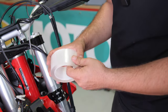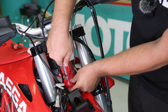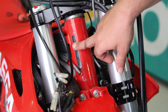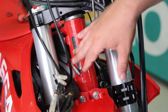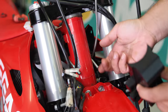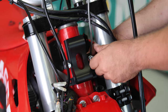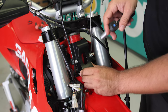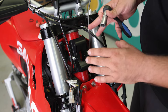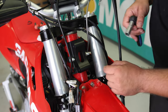If you want to protect the frame, you can add some special rubber tape on the headstock. I like to do this just to make sure that in case of any crash or anything getting loose, I won't damage the frame number. Put the washer and the nut then start tightening it — don't tighten it completely, just so that it's firm. Then put the tower and check everything is straight so that you can make any minor angle adjustments.